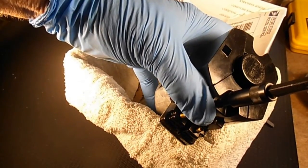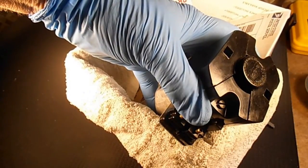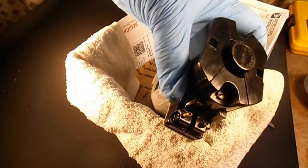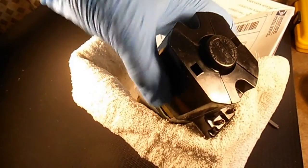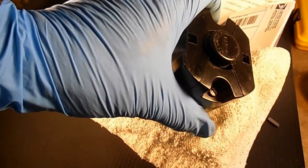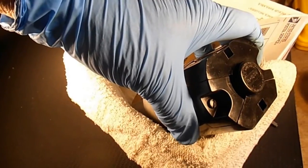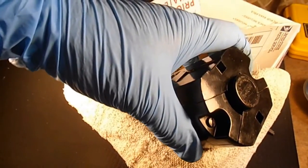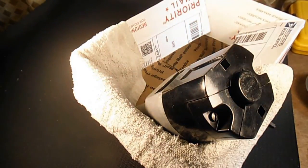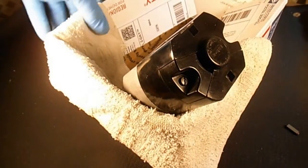And that's how you've changed or removed and reinstalled the brush on a Singer PA style motor. We didn't clean the commutator or brush out the old carbon dust — we just quickly and easily checked the carbon, replaced it if necessary, and then you'd go do the other side. Because that brush lead terminal can pop out, I just do one side at a time unless I have the whole cover off and I'm fully redoing the motor.